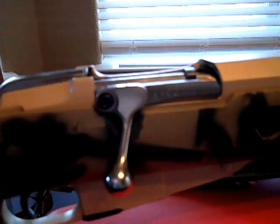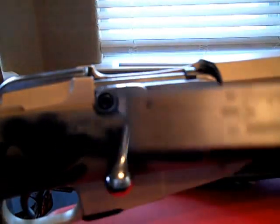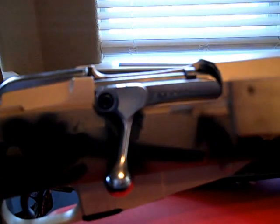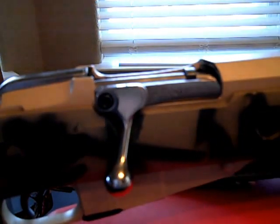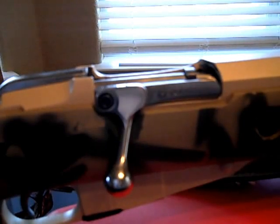Step one, you're going to have to cut the other bolt off. They're going to tell you how deep to cut it, and to be honest with you, there's so many variations of this bolt, and I measured to the amount they said. You know, you have the inside depth micrometer like this. I measured what they said, and it was wrong. So that's why I'm saying you've got to have a little bit of garage skill in this.